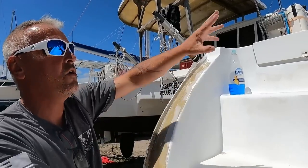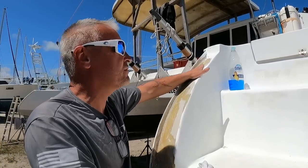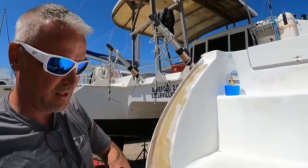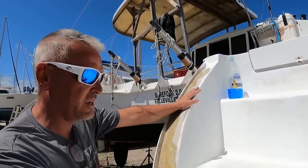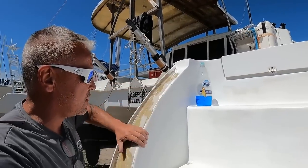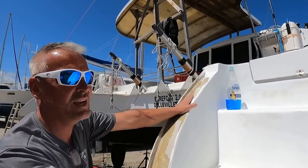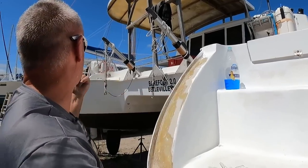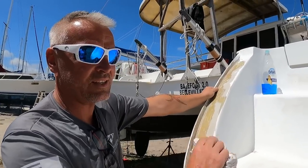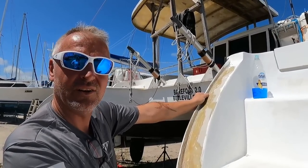Anyway, we've got it prepped now — we can't live in the past. We're going to do this whole area here. We're also waiting for new topside paint and we've got non-skid paint. I'm going to use TotalBoat epoxy fairing — it's the first time we've used that product, so we're going to practice with it here. Then as I get further up I've got a little more sanding to do, and we'll use the new topside paint, wet edge, and then the non-skid. A two or three day project to get the sugar scoop finished. We're all prepped and primed — I'll give it a good wash down, then an acetone wipe-down.